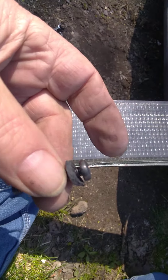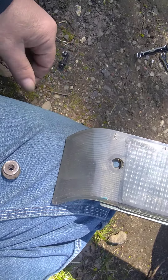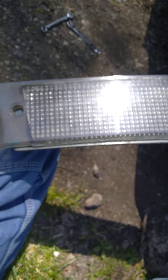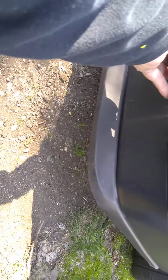The screw has a rubber grommet on the back side of the screw, because god forbid we did anything simple. There's another rubber grommet and a metal washer, and then we top it all off with a nylock eight-millimeter nut. In order to get the light out or in, that bolt has to be completely removed, otherwise the holes won't line up — which you'll see in a second.